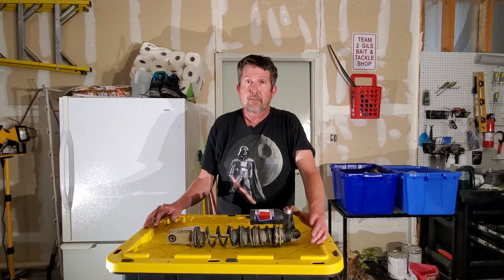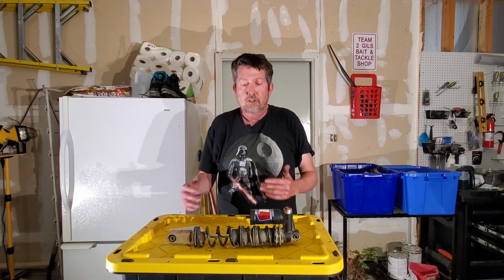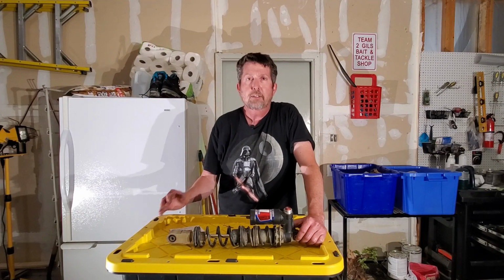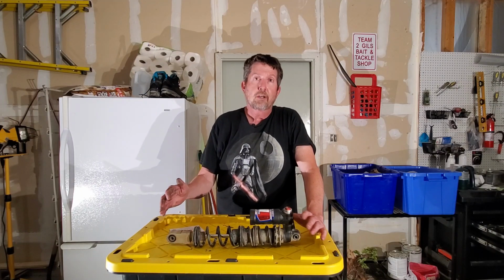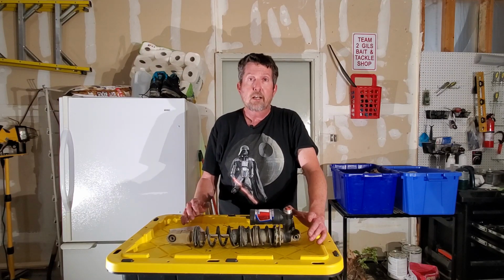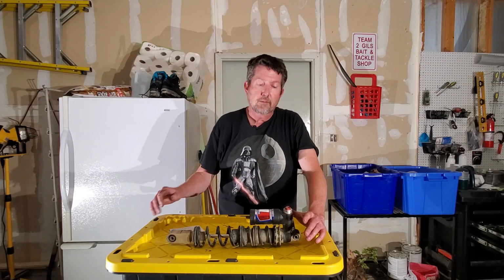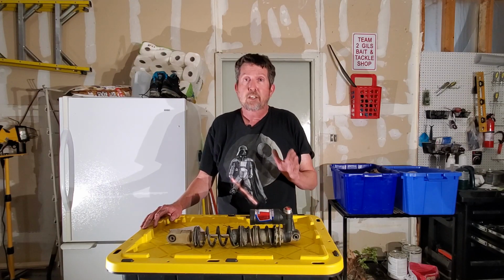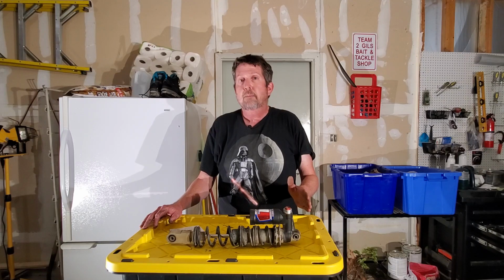If it comes back and it's better, you like it, it's not giving any adverse effects, go out 2 more to 19. Just keep doing that until you get to the point where, holy cow, it's getting better, it's getting better. Now, well, it's hard to tell. Then maybe it's actually getting worse. Well, if it's getting worse, that's gone too far. Go back to your last adjustment. You might get to a spot there where it's hard to tell if it's getting better. That's a good spot to stop and go to the next spot.